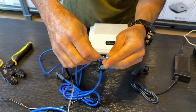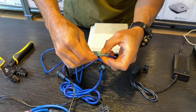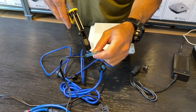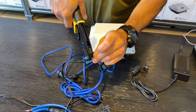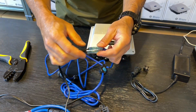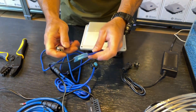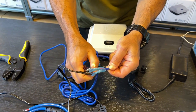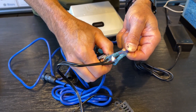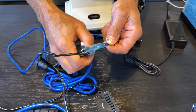The other wire is obviously my negative — that's going to get in there. These connectors are waterproof if you use a heat gun or a lighter to close them up. A heat gun is a little nicer with less chance of burning things, but a lighter does the job. If you heat these up properly you will get a good seal and it'll be fully waterproof.